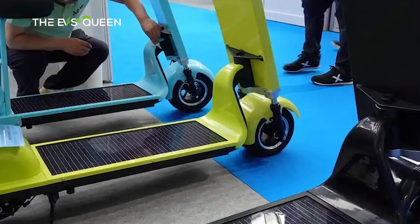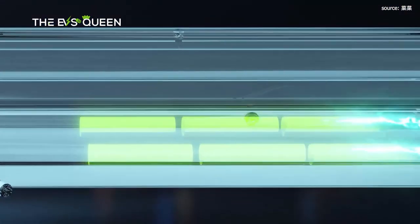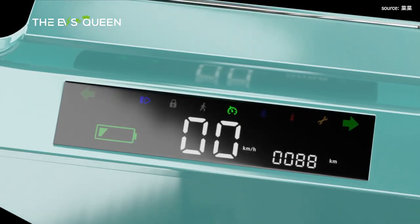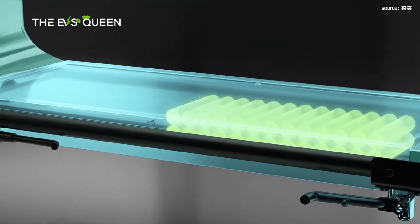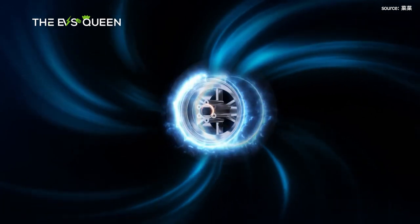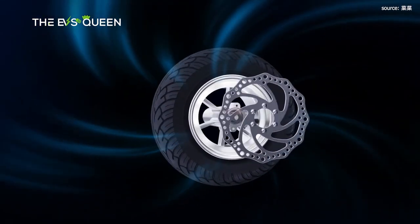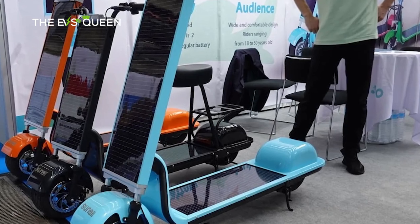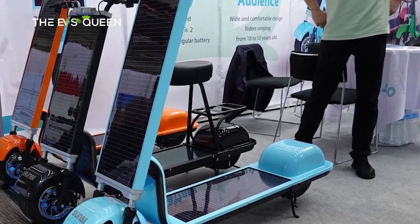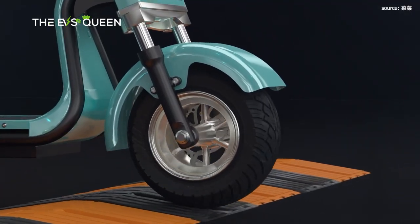The Chinese factory's representatives at the booth explained how the scooter works, offering somewhere between 35 to 70 watts of solar power to recharge the scooter. Considering the 468 watt-hours battery on board, that means a full recharge takes between 7 and 14 hours of sunlight. In other words, you can probably get between half to a full charge per day when the scooter is parked outside, and the back-of-the-envelope math tells me that you can cruise around town for roughly 11 miles a day on purely solar-generated electricity.